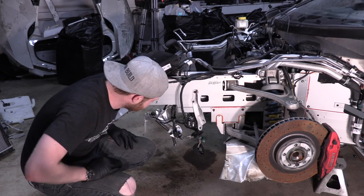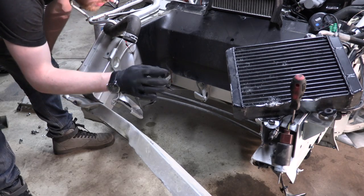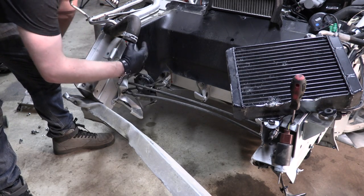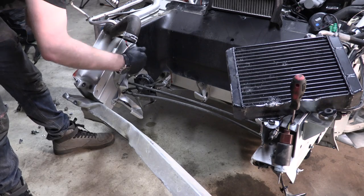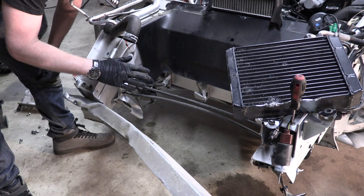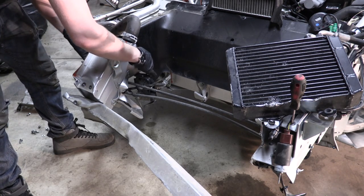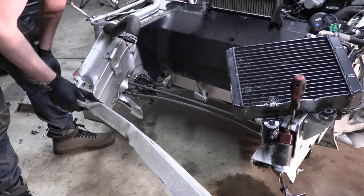That other side is completely done — cleaned off, no more miscellaneous hanging metal. The next thing I'm going to do is come in here and free up the transmission cooler and all this mangled metal to figure out where I need to make my cut. I'm going to make a cut far in, including some of the damaged stuff, because I don't want to accidentally cut too deep too early without a full game plan. I'll remove all this garbage, loosen up this hose area, then cut it off to free up the whole area before going under to work on that skid plate rock guard underneath.